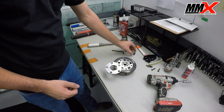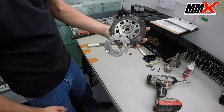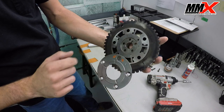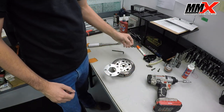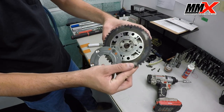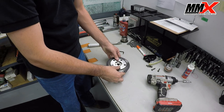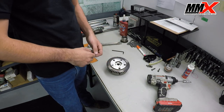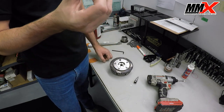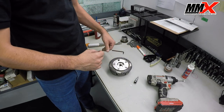The correct orientation to install the phaser limiter will be just above the tool. The way you know it's in the right spot is it will be contacting the inside of the phaser limiter with no gap like the other positions. Take the phaser limiter and install it, then put the plate right back. Apply a small dab of Loctite to each of the bolts before reinstalling them. One important thing: the long bolt with the pin goes back where the tool goes — it's very important it goes back there, otherwise it will allow your phaser limiter to unwind.